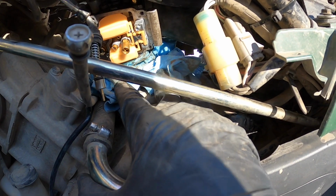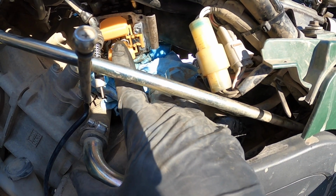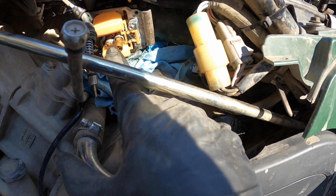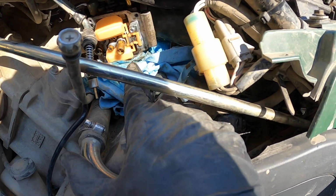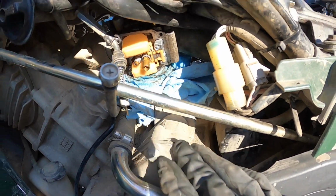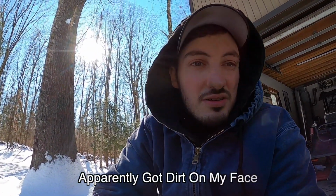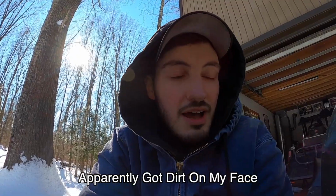And this has already been jetted up a little bit everywhere else, but always follow instructions. HMF actually did include a jet kit with the kit, so it told us how to jet it. So I'm just going to throw it back to the old jetting, and that should make her a lot richer. We're going to have more air, more fuel, which equals more bang, which hopefully equals more power. We're going to find out.